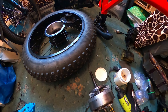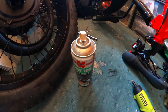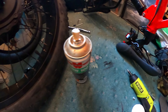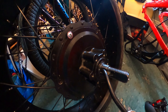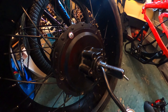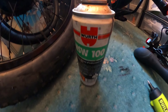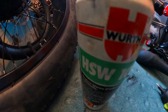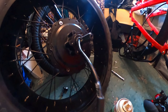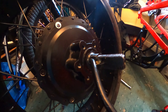I've greased it. I got more of the old grease out - the black stuff was really thick and didn't seem smooth on the gears. I've greased it with this white grease I've had for years. In Part 3 where I attempted to fix the motor it was still noisy. Someone commented saying replace the gears, but the gears don't seem noisy when spinning it out of the hub.